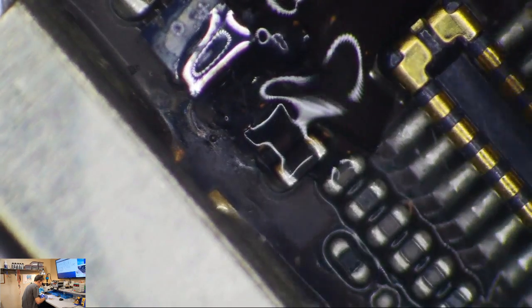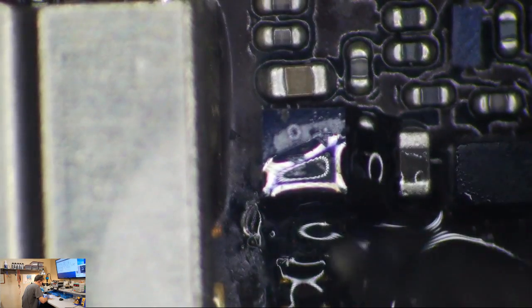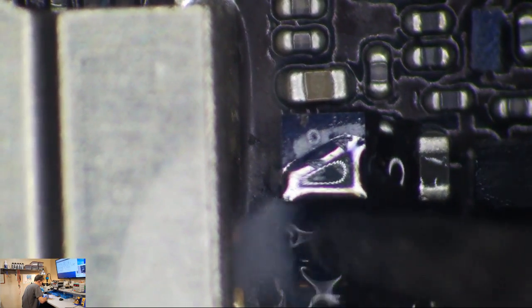It's already detached - it's just sitting there. We're gone, it's not even there. I should have touched it before putting flux on it - I would have known that was completely detached. We're going to get in and scratch around with these pads just a little bit and see if we have any pads. Something tells me since we're dealing with the same circuit as the 6S, that there's not going to be a pad to speak of here.